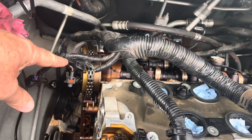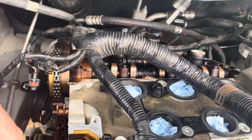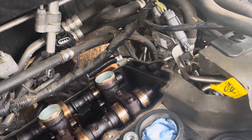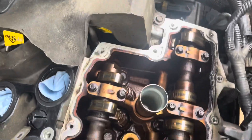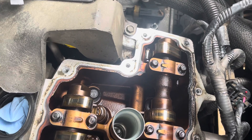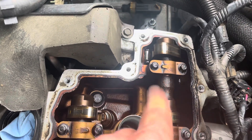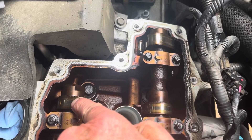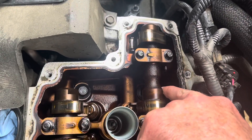This is the right side — you take off the right side chain, rotate the engine a little more, rotate around again, and then do the left side chain. I've rotated the engine a total of 720 degrees so these flats are back straight up on these cams. This cam here must be a later model because it's got a direct injection fuel pump — a mechanical fuel pump — so this must use a different kind of cam locking tool. There's a flat right here, so I'd use a different tool than the older versions required.